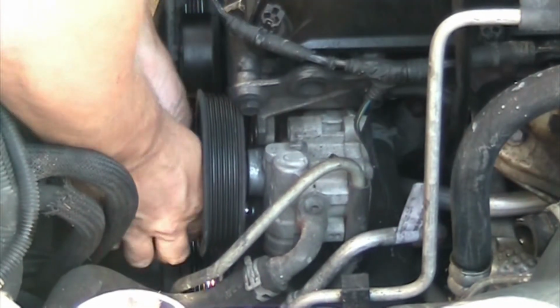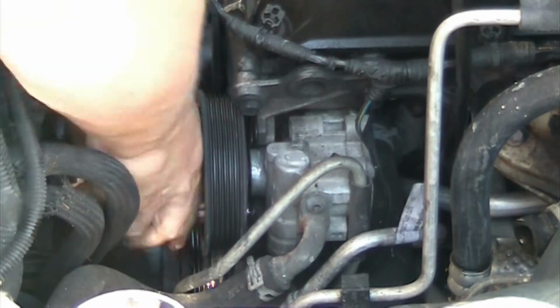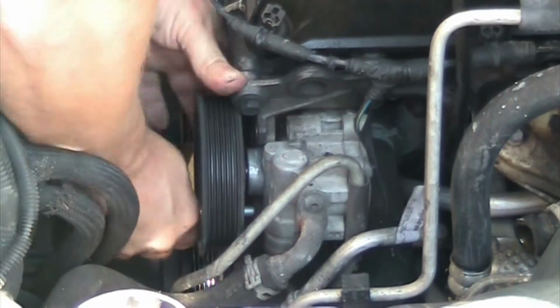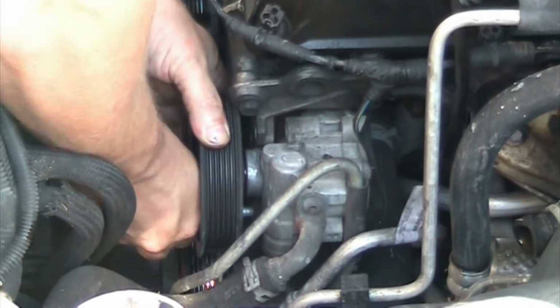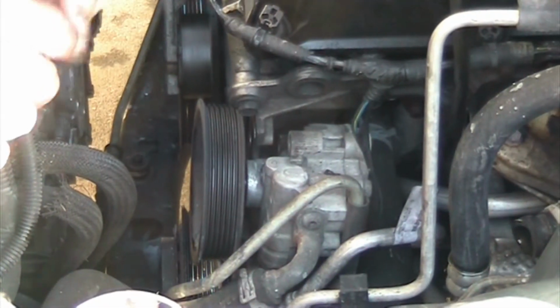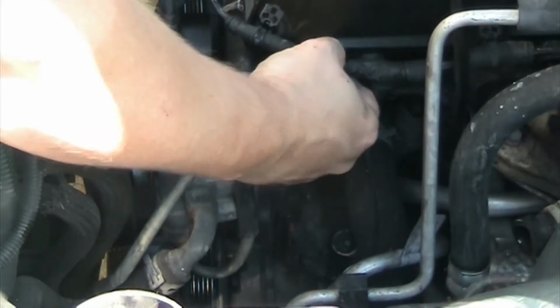So yes, engineering wise they make the most out of the space in the engine, so that you have everything nicely tucked in and the engine bay doesn't have to be super big. But the tighter you build things together, the more the heat is also trapped in that whole bay. So that's another big problem. The whole engine, because it's aluminum, needs to be at a good temperature in order to run good. Not like the older steel blocks, which ran a lot cooler. So aluminum likes to run a little hotter.